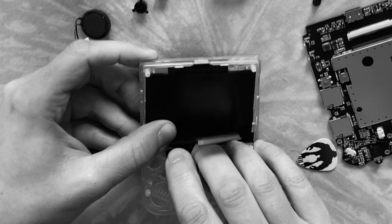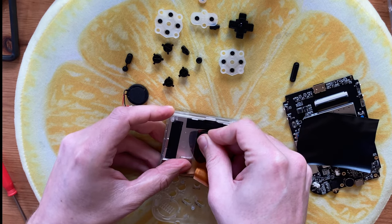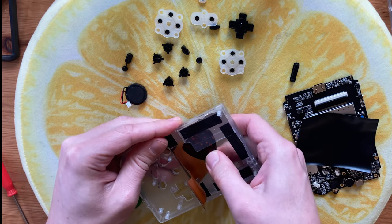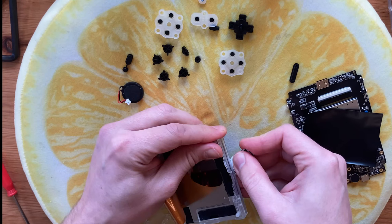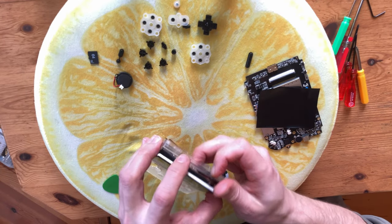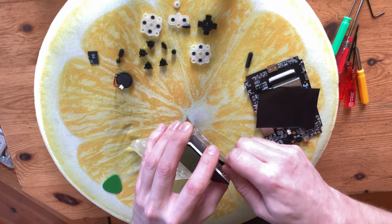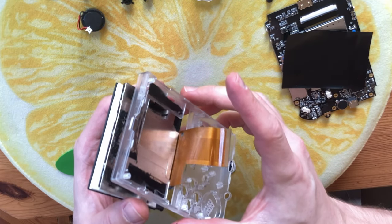Then take out the speaker by using a small flat head screwdriver. Whatever you do, do not try and force out the display when you're unsure of how it can be removed. Worst case scenario, it will break your screen, rendering your handheld useless. Remove this covering. From the back we can see that the display is held in by 3 pieces of double sided tape. I'm going to attempt to cut this tape — don't do this! The guitar pick here actually broke the surrounding plastic. We can use the guitar pick to pry out the display from the shell. The display has its own protective case, so get the whole thing out rather than put any more stress on the display. And at last, we can pull it out.